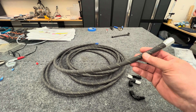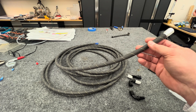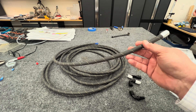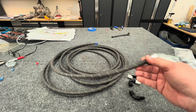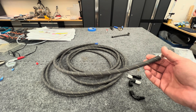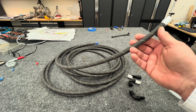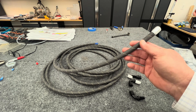Doing a lot of online research, it seemed like the stainless braid could be pretty chafing to anything resting up against it over time. Whereas the nylon coated, I thought would be better for that. Also it's lighter weight than the stainless steel, and I really didn't feel like I needed stainless steel level quality. This is not running down the bottom of a car where it's going to get road debris. So this is what I went with. Aramid is like Kevlar — it's a competing version of Kevlar, a synthetic that's very tough.